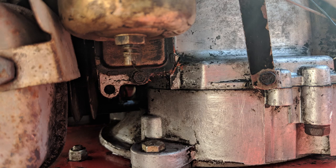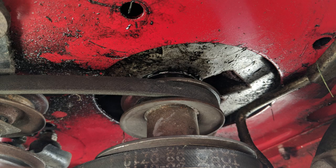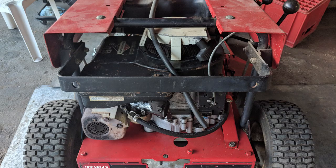There's an oil leak coming from the valve cover and someone tried to remedy that with orange RTV silicone. But the most extensive oil leak is under the engine and that's most likely coming from the crankshaft oil seal, so that'll need to be replaced.